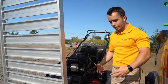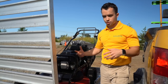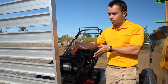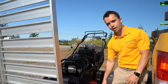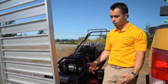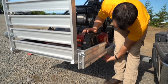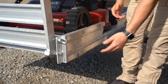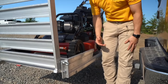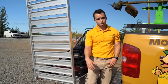Down the road we'll probably have to custom fabricate something because we'd like it a little more rigid, a little more sturdy, and about two inches wider. Because we cut the rack and compromised the structure, underneath we had to put a piece of metal to reinforce the edge so it doesn't start bending. Since it is aluminum and isn't super rigid, we had to do a bracket that reinforces the floor of that rack.